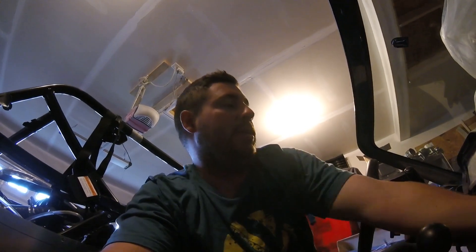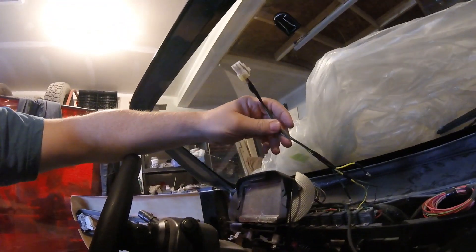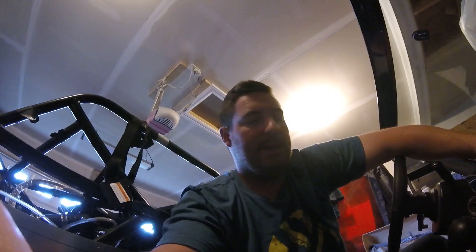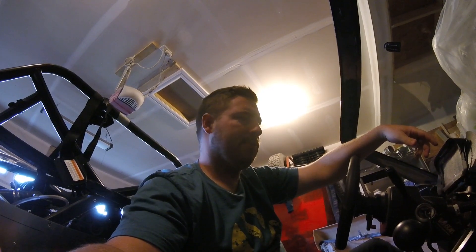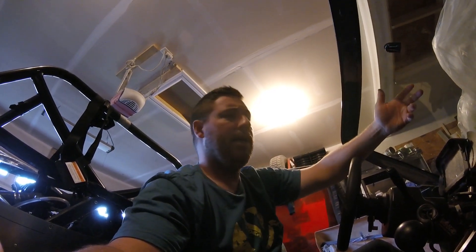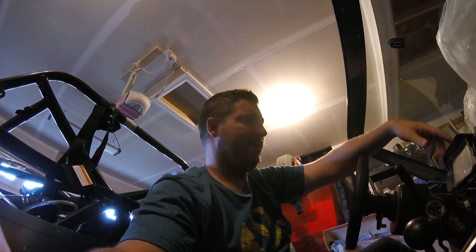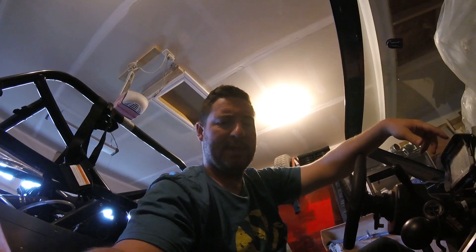I wired up my emergency — I'm using just a Subaru emergency switch, that's the connector for it — and I spliced in these two guys which were supposed to plug into that. But somehow when I wired that up a couple of months ago, I spliced those two little connectors into the wrong end, and those are actually 12-volt and not a switched ground. So I've got to tear back into that and figure it out, see if I can find a switched ground on my relays.